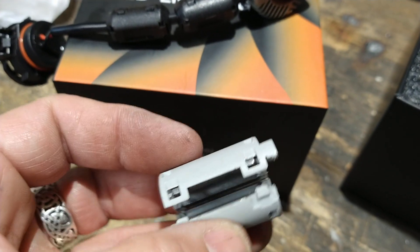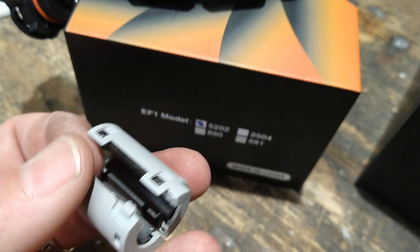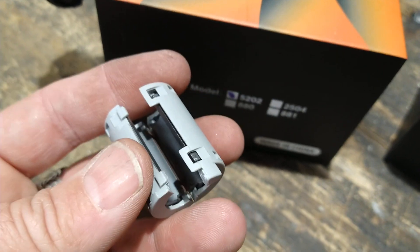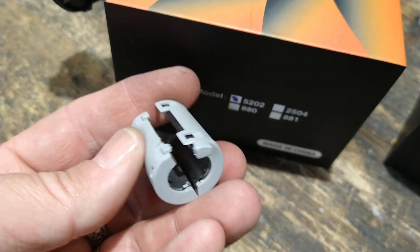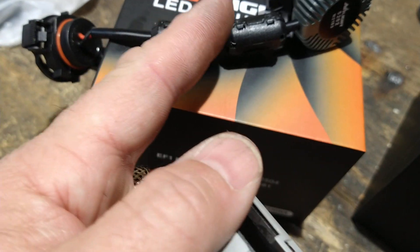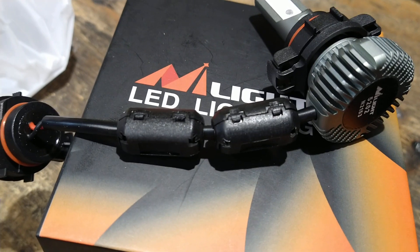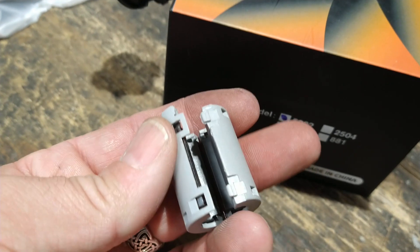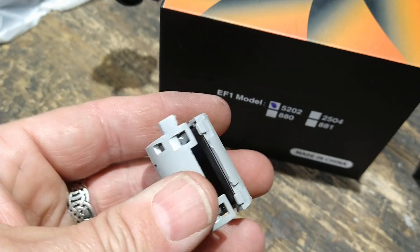That's a little tip. Also, for you guys into CB radios — if you have any interference from the ignition or anything else in your vehicle coming through the 12-volt side, not through the antenna but through the 12-volt wiring, you can wrap your 12-volt wiring with these. Get a larger one and get a few wraps through there. If you've got LEDs and a CB radio, these are a killer on CBs at nighttime — wrap them up. You want to get it as close to the item as possible so it knocks it out right there. I know it kind of seems like voodoo, but they really do work. I knew about these, but 350 radio really nudged me to get these ones in particular, and they definitely do work.